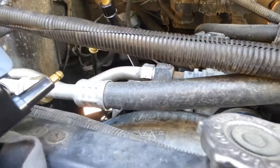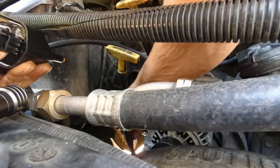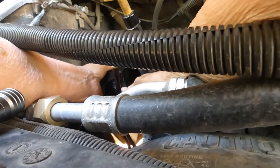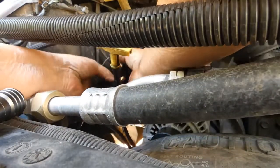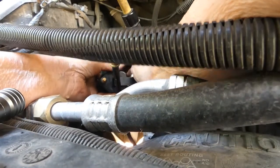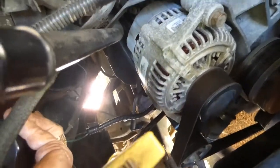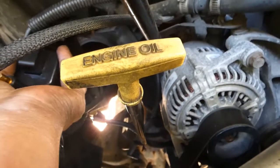I'm back at the car. To make life easy for me, my plan is to connect the electrical before I put this back on. It's really hard — it doesn't want to just pop on there. That's why I wanted to do it with it loose. There we go — did you hear the click? All right, so I got that connected. Now I'm going to get my flashlight down there and find the mounting hole. It's down there somewhere, and I'm going to put the ground wire back on there too.